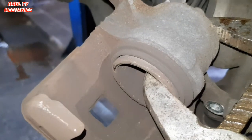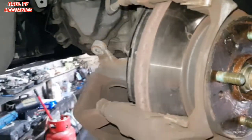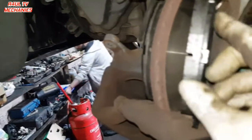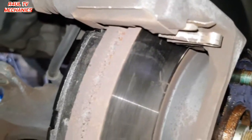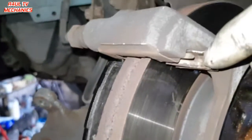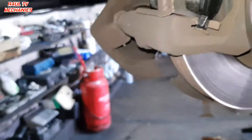To refit the pads — I've already got the rear inner pad on, so I'll show you the front one, which is exactly the same. You need to line up the pad with the little grooves and cutouts on the bracket — there's a groove at the top and a groove at the bottom. The pad needs to sit right in those slots on both the top and the bottom.